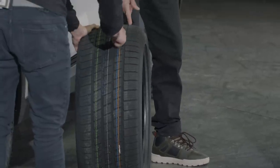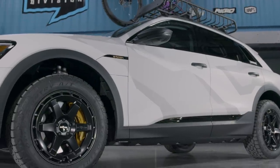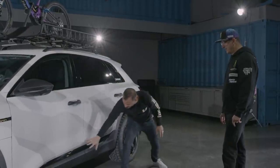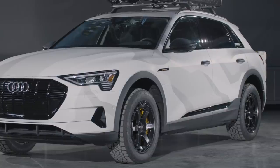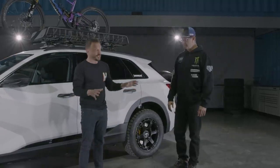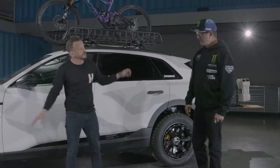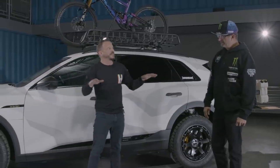You no longer have a huge heavy engine in the front — it's all under here, so the balance of the car is completely 50/50 front to back. We've talked a little about batteries and weight balance, but important things — power and torque. About 490 foot-pounds of torque, pushing towards 500 horsepower. The powertrain pushes power to the back and front separately — most of the time you'll never notice it, but it's actually in rear-wheel drive and activates front-wheel drive when it needs it.